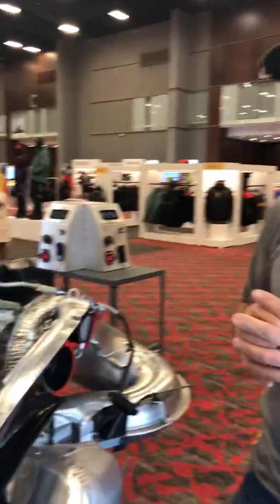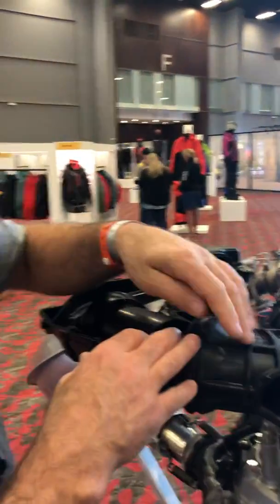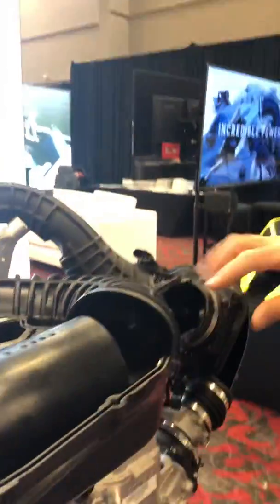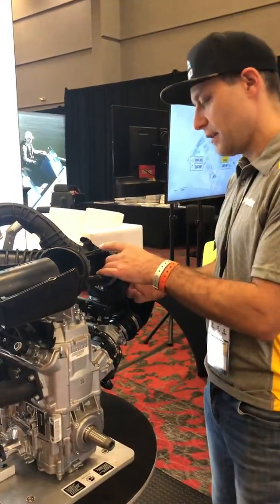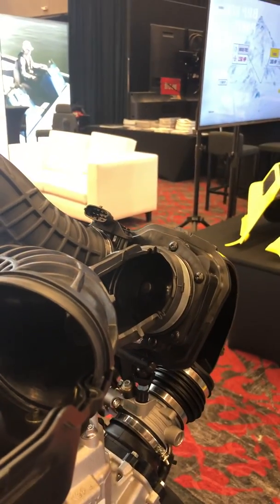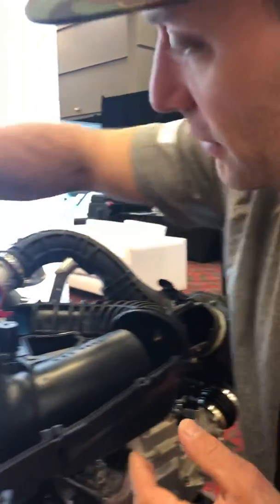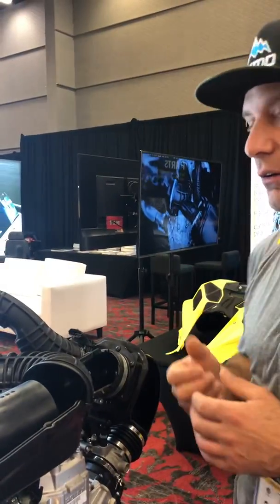Yeah. And how about the airbox? That's another key part of the response, right? Yeah, so you have a normal airbox here. This run goes to the intake side of the turbo, and then it goes through the compressor wheel and into the airbox. But also right here, at very low RPM, or when there's no pressure in the exhaust, to have good throttle response, this thing acts like it's naturally aspirated for a split second. So not always, but if it's right at a dead idle and you smack it wide open, it'll breathe through the bypass valve, because the engine needs a big gulp of air. And as soon as the air goes through the engine, comes through the exhaust, builds pressure in the turbo, then the impeller speeds up, pressurizes the airbox, and away you go. And it happens really in a fraction of a second.